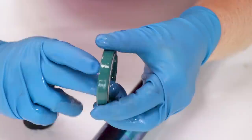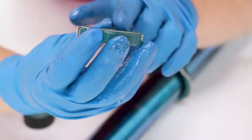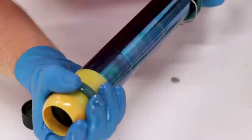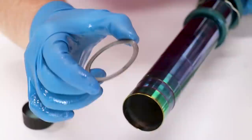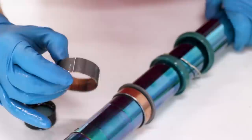We've got a clip, and then the actual oil seal — you want oil on the inside of this as well. For this one you want the taller lip facing the bottom of the fork, so it goes on just like this. Then the bullet can come off, followed by a washer and then the thinner bushing. Finally the fatter bushing, which fits right into the top groove on the tube.